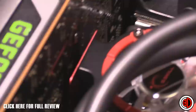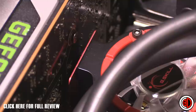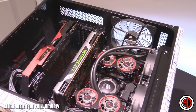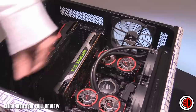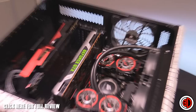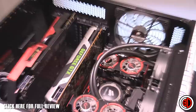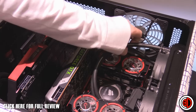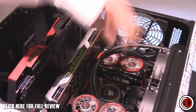That gap sets off alarm bells. Look how close that is to the back of this 780 Ti — it's not got a back plate, but there's quite a lot of expensive electrical componentry there. These really aren't fitted all that well; they don't grab hold of any of the actual RAM modules. As soon as you stand the case up, it does eventually find its way back down and touch the PCB. With an expensive graphics card, this would make me incredibly, incredibly nervous. Any AIO water cooling hose could also get in the way.